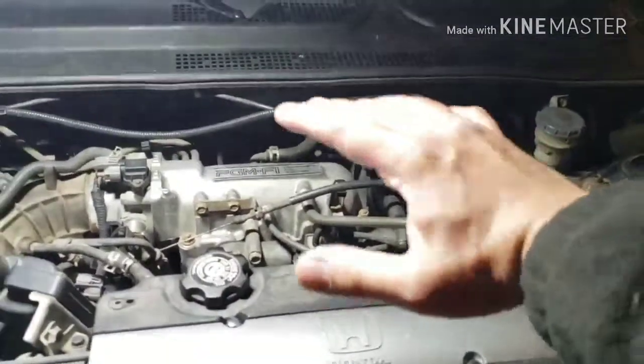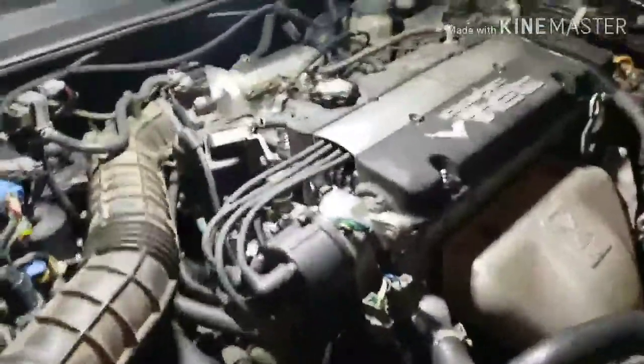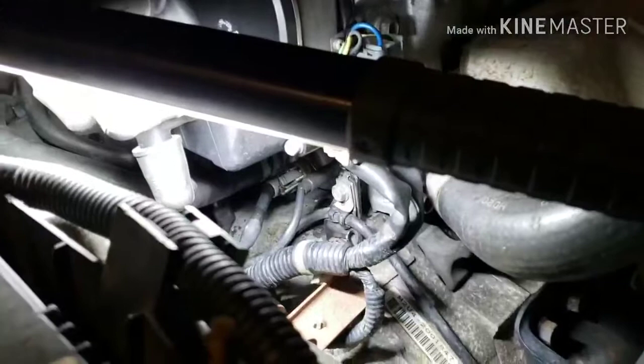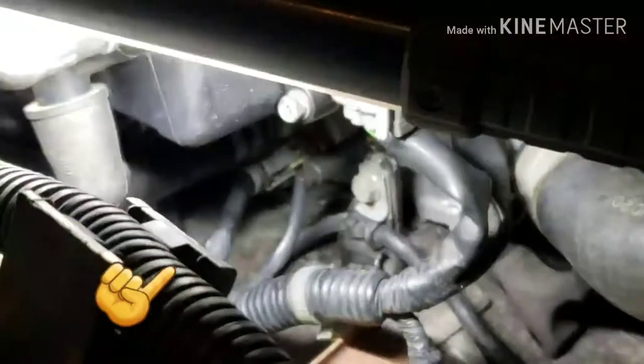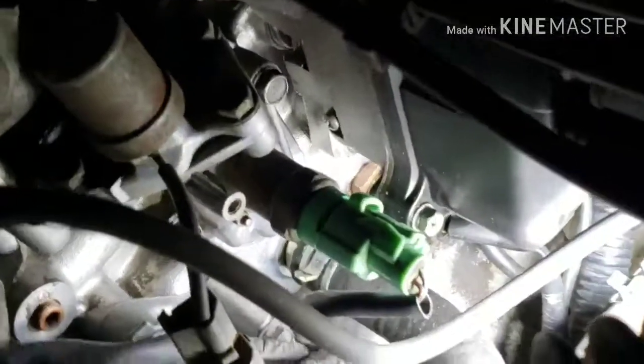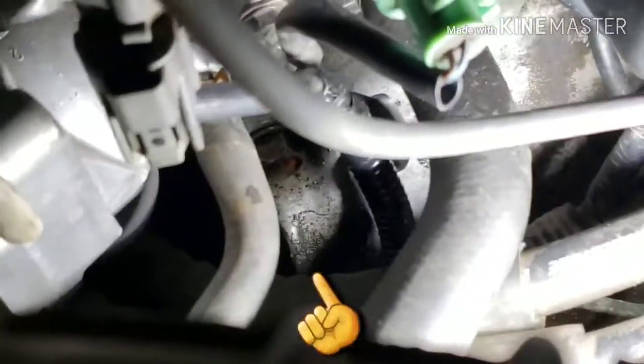That's where the oil filter is, and there's no oil leaking in the back by the oil filter, by the cooler. Basically it leaks going down to the transmission, and I don't know if you can see it here. You see that wire connector is wet. And you can see on the bell housing on the top of the transmission that evidence of a spot of wet oil.